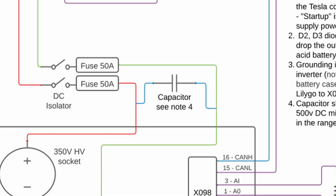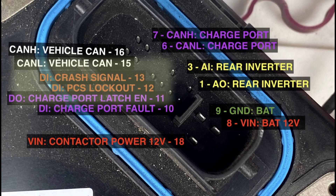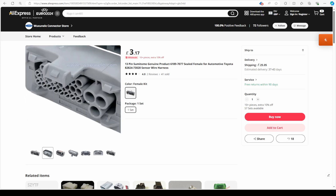Tesla moved to a small lithium pack to replace the 12-volt lead-acid battery. I guess I could build a lithium pack for closing the contactors — I have spare cells. This whole circuit is going to need fuses. I also need a capacitor between the high-voltage battery and the inverter as a requirement for the contactors in the battery to close. This mimics the connection of a rear-drive motor in the EV. I will most likely need a new pyrofuse too. Most of these packs come from crash-damaged Teslas which didn't sustain pack damage. As a safety protocol, Teslas tend to blow the pyrofuse when they get a signal to say they've been in an accident — more specifically when an airbag goes off. I need the relevant plug also to connect to the battery's communication port and a small resistor to trick the pack into activating.